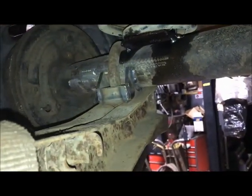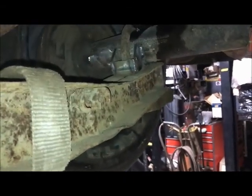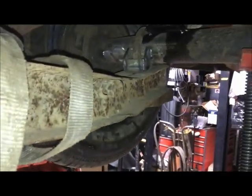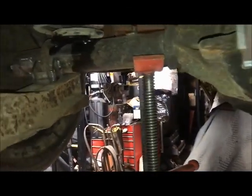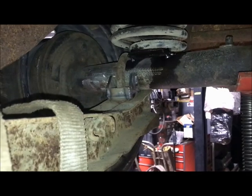One thing I just wanted to go over, the only reason I was able to do my final welding on the perches here to the axle is because this is a truck arm suspension and not a leaf spring suspension. The truck arms move in an arc. You know, if you imagine a pendulum, they've got a fixed point and they swing up and down. So as long as I had the axle at ride height, which I did, I had it raised up to ride height position on the car, I could set my pinion angle and weld those brackets on.